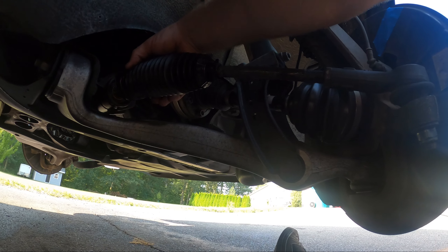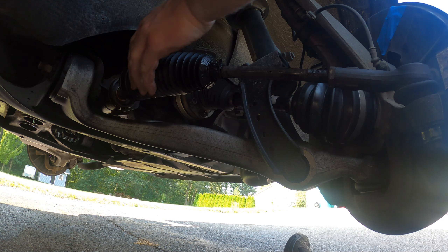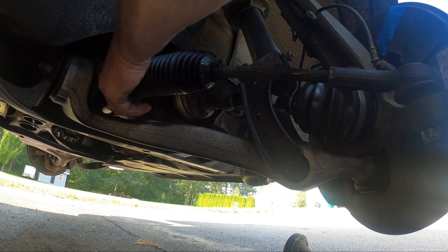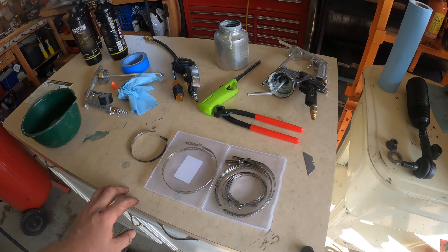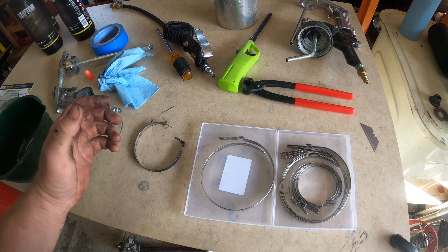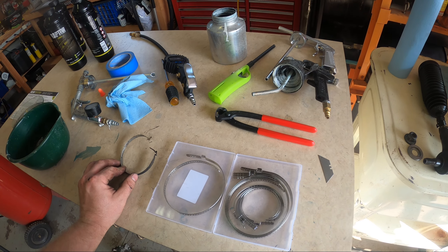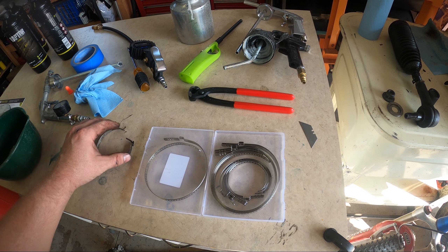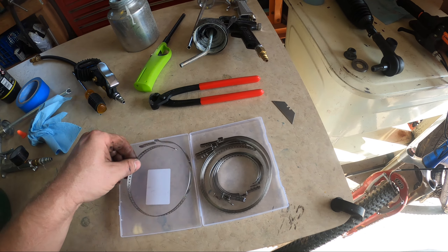I've got a new crush-type clamp for that, but I don't want to put it on while fully extended because the boot would be stretched out. I'm going to turn the wheel back to the right so it's a little compressed - it'll also help hold it in place while we crimp on the new ring. Here's the old one - pinch style, it's always been a pain. I don't have nice stuff so I've always used worm clamps which just suck. These new ones are low profile in there.